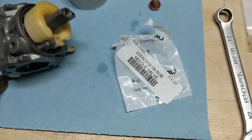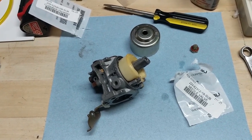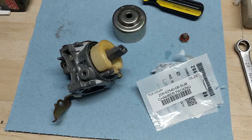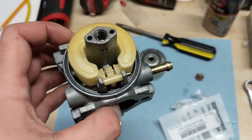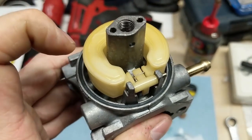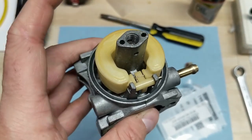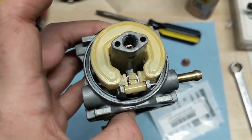The bowl gasket was fairly cheap, but the needle valve cost $47.99 — with 13% HST here in Canada the bill was almost $73. It's a pretty unbelievable markup, though I know the place I bought from didn't mark it up much because it is a Subaru OEM part and manufacturers like to charge way more than what these parts should cost. I wanted to use OEM parts so I know there won't be a problem. I cleaned the carburetor five times in the ultrasonic cleaner — twice with boiling water, then another three times as the water cooled — then blew it out with the compressor, so it should be good to go.